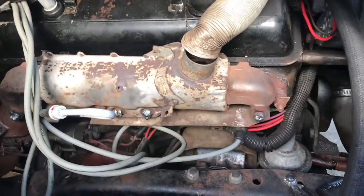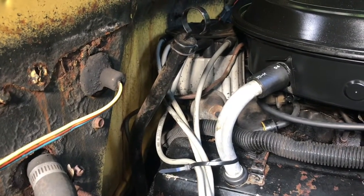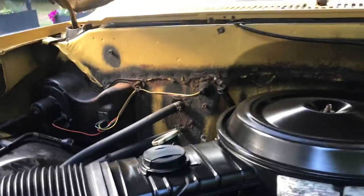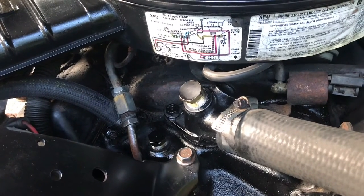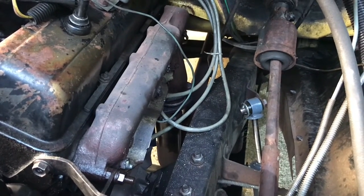We've taken all that junk off and welded up the holes. I took all those vacuum lines off. You may have one going down to your transmission if it has a vacuum modulator — that steel line right alongside the distributor cap goes down to the transmission. You might also have a line going to your heater control. Those should be vacuum lines, not the heat-activated switches. We're cleaned up, I'm happy with the situation, and thanks for watching.